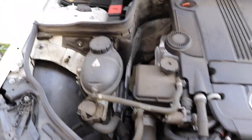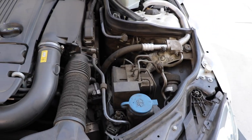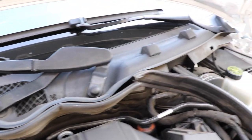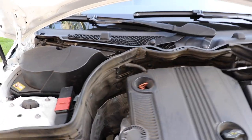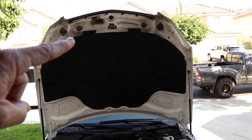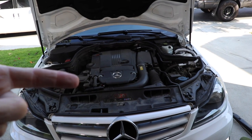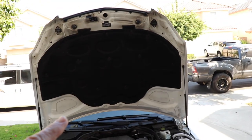I like to do a pre-inspection — check where the really excessive dirty parts are. You'll have accumulation of dirt combined with an oily type of residue. Also up front you often get dry debris like leaves and pine needles — it's better to remove that first before you introduce any liquids. My rule is to clean the bottom of the engine first, because if I clean the hood first, that solution drips down and dilutes the chemical on the engine below. I want to tackle the really dirty main part first, then go up to the hood.